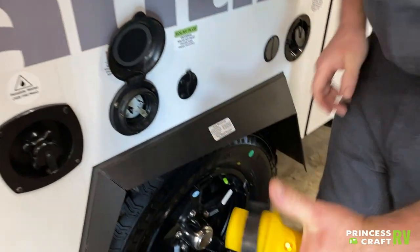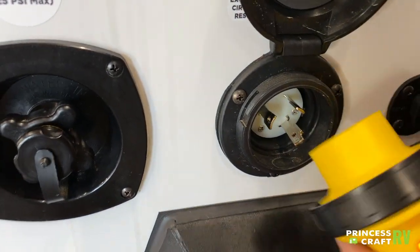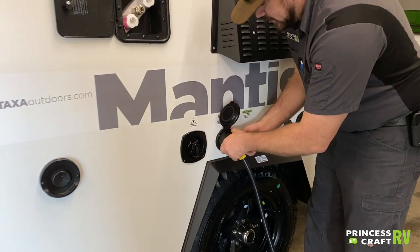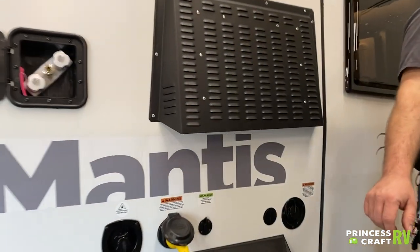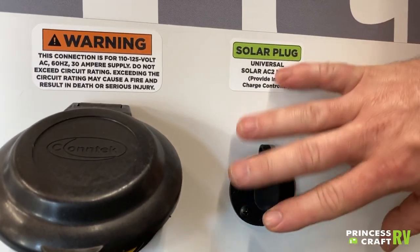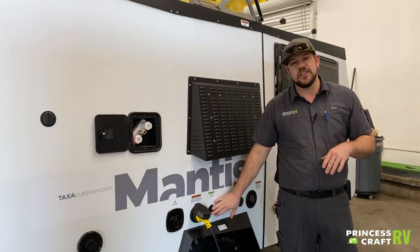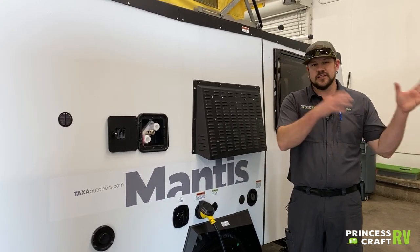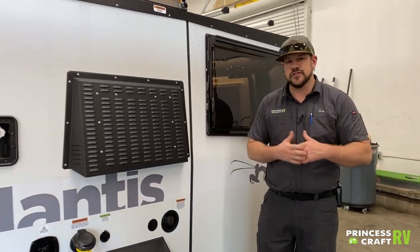Push the 30-amp plug on, turn slightly to the right, and use the lock ring to snug it down. Just next to that you'll find a solar plug — a little two-prong connector. Any portable solar panel can be hooked up to this, which takes the sun's energy and throws it into your battery to help recharge. While dry camping, this can extend your time before needing a generator or shore power. Just above that, this big black shield protects the air conditioner coming through the wall — don't cover it, especially when the AC is in use, or you'll cause issues.